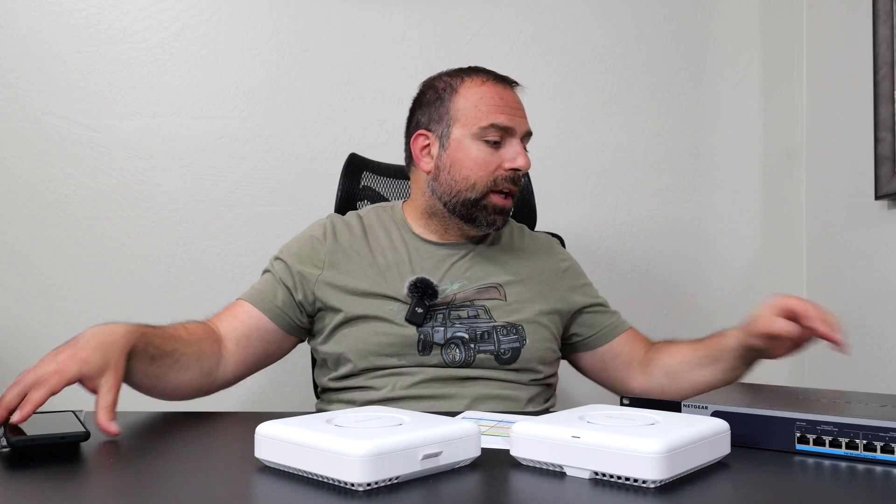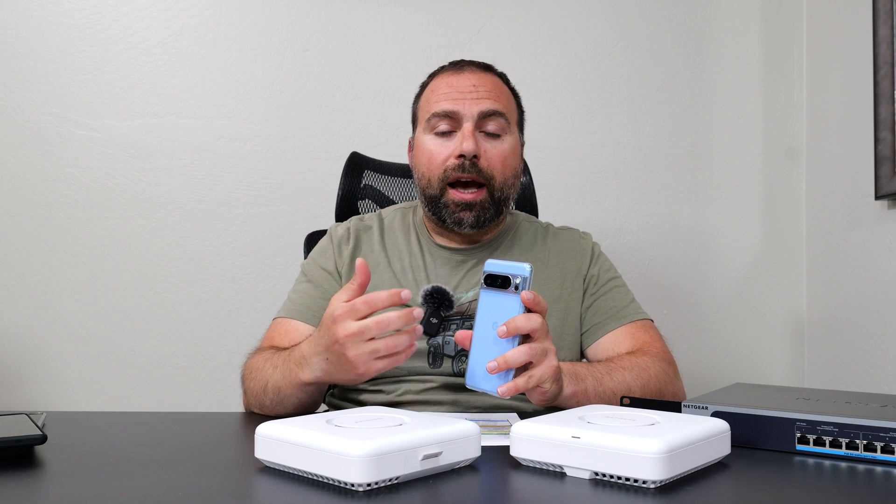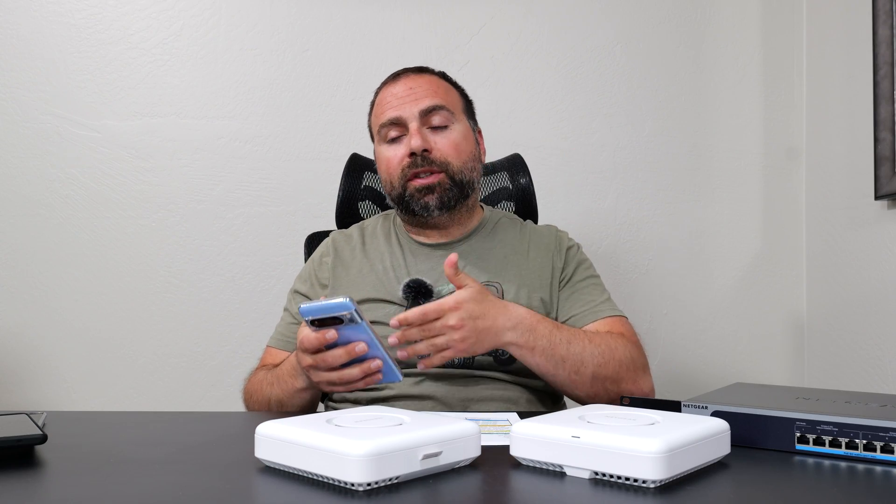It's been about two weeks since I unboxed this, and I've been using it in my main network with a chance to do all my speed and range tests. Just as a heads up, if you have a Pixel 8 or 8 Pro, even though it's a Wi-Fi 7 device, it's unable to achieve Wi-Fi 7 speeds. The reason is the Pixel 8 or 8 Pro can't connect to more than one band at the same time. That's one of the new things with Wi-Fi 7 called MLO — multi-link operation — which allows your Wi-Fi device to connect to multiple bands simultaneously for much faster speeds. The Pixel 8 or 8 Pro is basically a very fast Wi-Fi 6E device as of now.